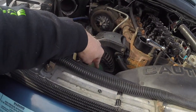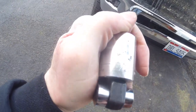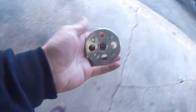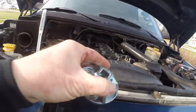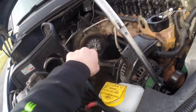To get your engine turned to top dead center, a lot of guys will use the alternator bolt — I believe that is a 15/16th. You put your breaker bar right on there and turn that. If you need to, you can put just a little bit of pressure on the belt. There are also barring tools — one is this one right here from Fleece Performance that goes on the harmonic balancer in front. You pull your four bolts out, put this back in place, then use a half-inch breaker bar to turn your engine.